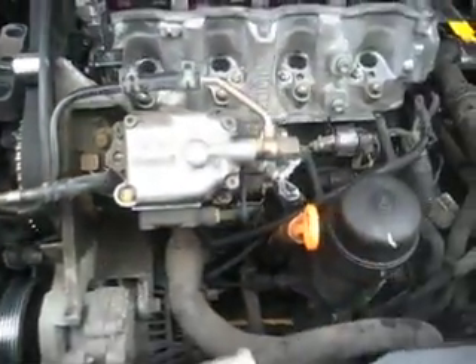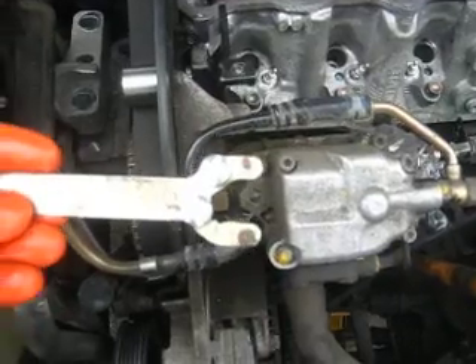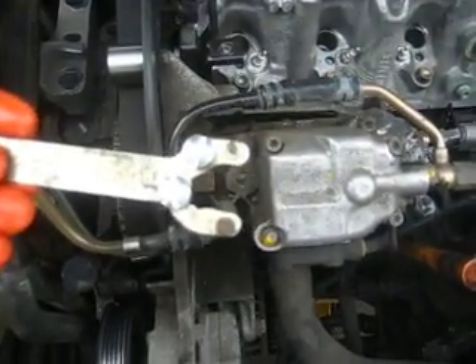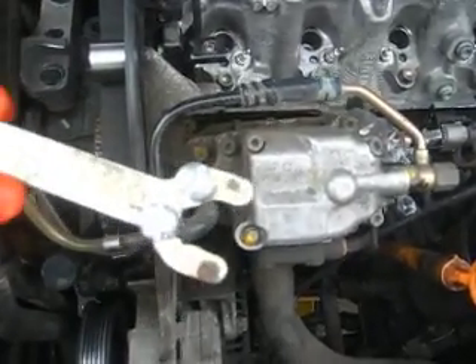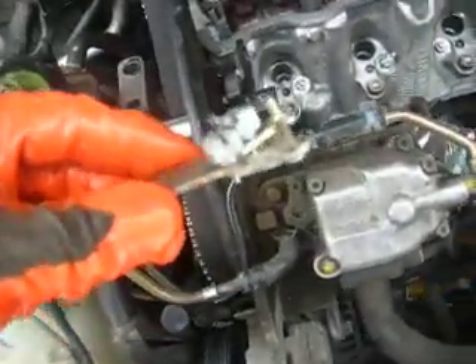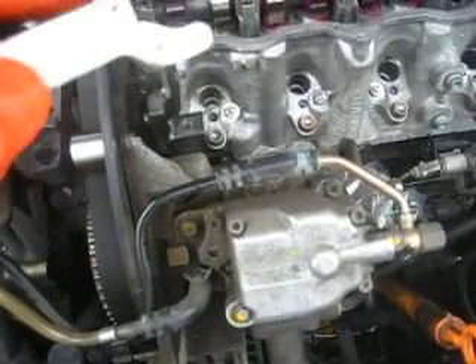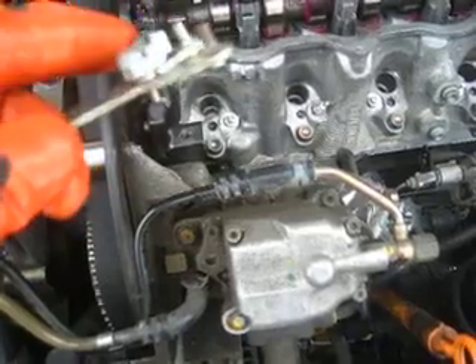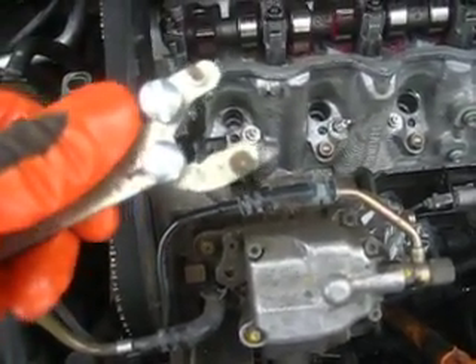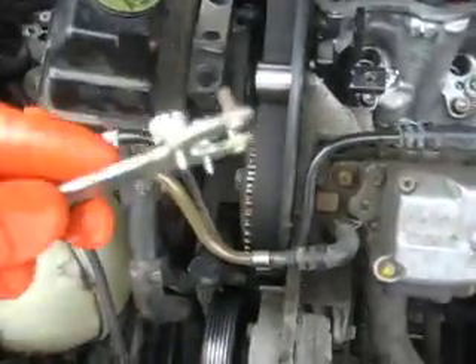The only other tool I needed was the one for locking the tensioner, and of course with a drill and a pencil. Because you're putting on a new tensioner, before you put it on there you go ahead and stencil out the holes on the new tensioner. Take a piece of metal — whatever kind you have — and stencil out the holes on it, drill them out. I used readily available screws for computers. I think I drilled them out to one-fourth of an inch. You want to make sure that you're dead on center. And this worked beautifully.